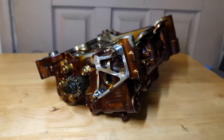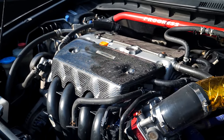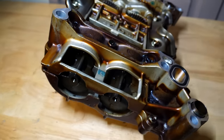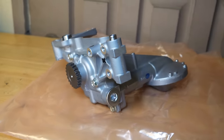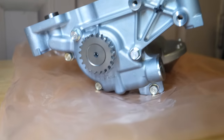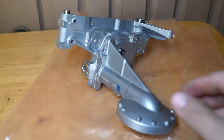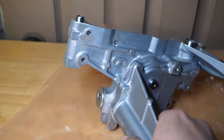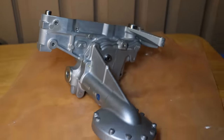The stock oil pump, however, is not quite that capable. The rev limiter on a stock Accord prevents the engine from revving past 7,200 RPMs. The secondary forces from the crankshaft get cancelled out by the balance shafts in the oil pump. When the stock oil pump revs upwards of 8,000 RPM, the oil cavitates and the pressure drops, which leads to engine failure. To get around that issue, I'm swapping the pump for one found in an older Acura RSX engine. A straight swap will allow the engine to rev to 8,000 all day long without any issues. However, to rev past that reliably, that pump needs to be ported more, which moves the cavitation threshold from 8,000 to well past 9,000 RPMs. This is by far the best insurance you can buy for any K-series engine.